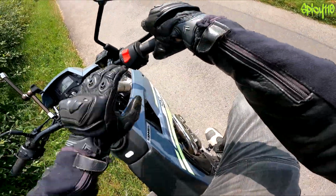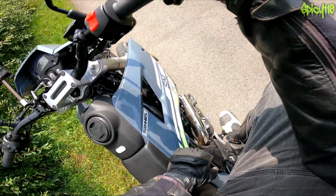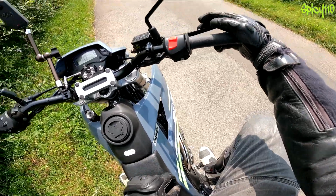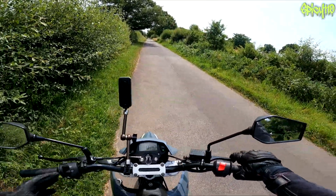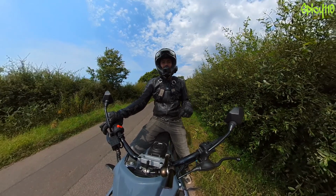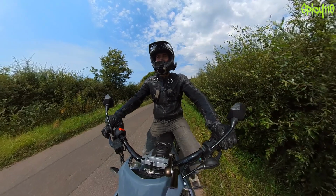One of them, I mentioned before, I thought this bike might be running a bit lean because the exhaust pipe is blue and purple all the way down the mid pipe. It's quite a lot. I think that's more because this exhaust is so restrictive, because it's got to be getting past Euro 5. I don't know this for sure, but one of the dead giveaways is the fact that this bike's noise is all induction and EGR valve.